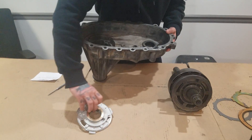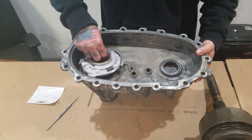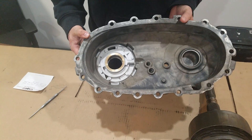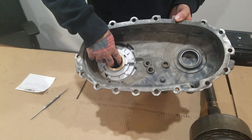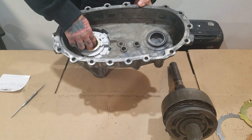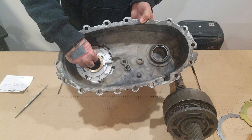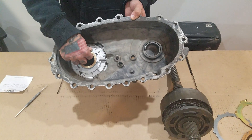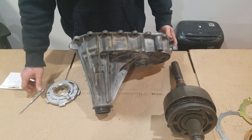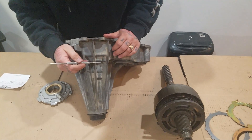The pump sits in like this, and the main shaft — the output shaft here — spins of course to actuate the pump. And when it does, it puts constant pressure on one side of the case. That constant pressure and vibration wears holes into the case, it creates a wear pattern into the case, and it creates a tiny pinhole right here.